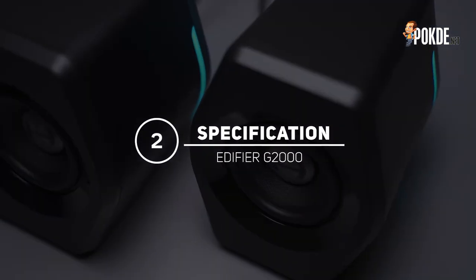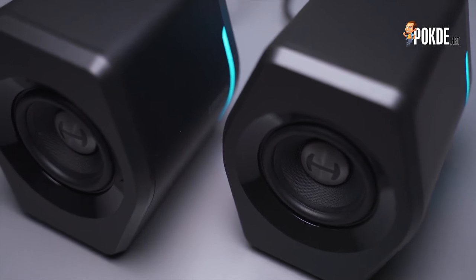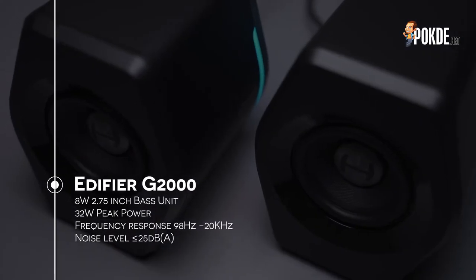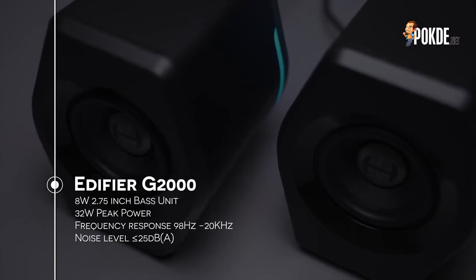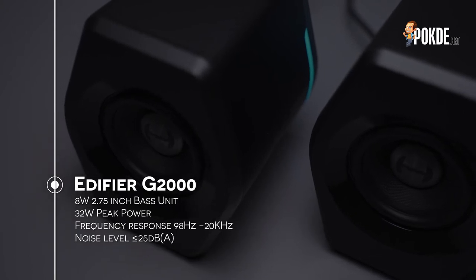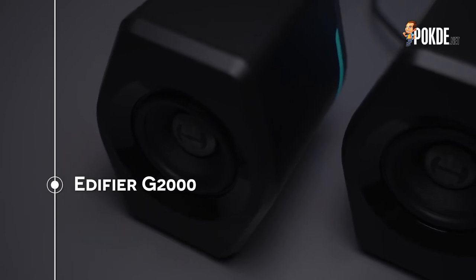Moving on, the specifications of the Edifier G2000 aren't particularly mind-blowing, but we do see that Edifier made full use of the available space in these diminutive speakers. You get huge 2.75-inch drivers that are capable of outputting 8 watts each, with a peak power output of 32 watts. The frequency response ranges from 98Hz to 20kHz, while the noise level is rated at below 25dBA. Nothing too grand, but they are pretty good when you consider the size of these speakers.